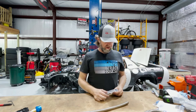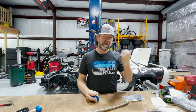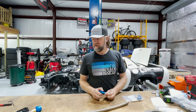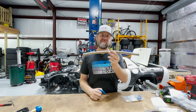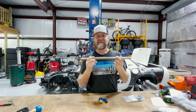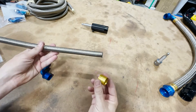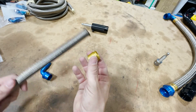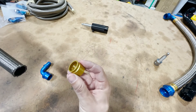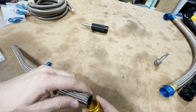We're going to start with the side that's harder to get to, which is the 90 on the oil pump. I believe this hose — if you watched one of the other videos — the oil feed line was the wrong length, about an inch short. I think I understand what happened: I probably cut the right size, grabbed the wrong one, and mailed it off. I think this is the right size because this side has already been flared open. You need to put your sleeves on first. Normally you slide them on from the other end, but since this side is already flared I'll slide it on this way.